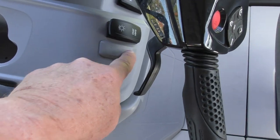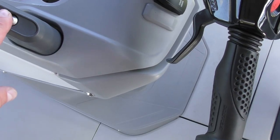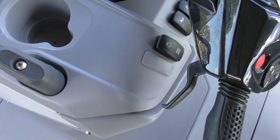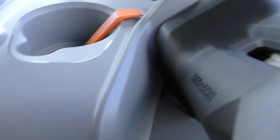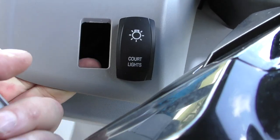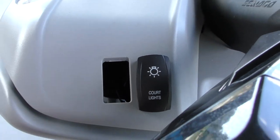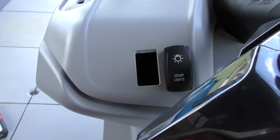We're going to need to route the switch. The instructions call for putting it here, so I'll need to take this screw off and lift this panel up so that I can route stuff down in there. Now that this piece is out I can reach up underneath here and lift this up. The cover pieces — you can see these little tabs — you can reach up underneath with your finger, push the tab in and push one side out, then up around and push the other side out, and that'll give you access to that panel. If you want to put it on this one you probably can, but the instructions tell me to put it here and I generally like to follow instructions.